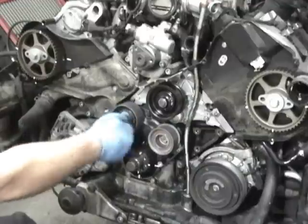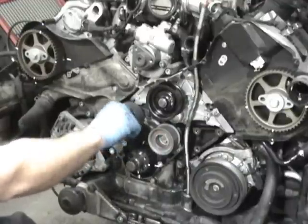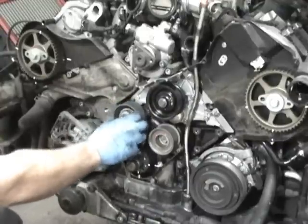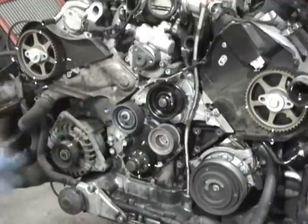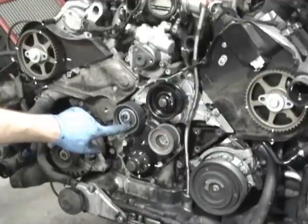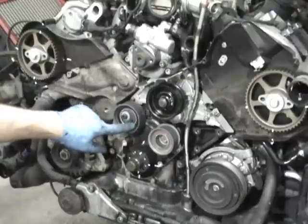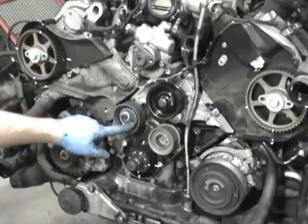And there's a washer on each side, and this is that 6 millimeter Allen. You could tighten this down and that ends up moving like that, and this arm pushes on it. So we'll torque that down to 18 foot-pounds, and you'll see that there is a hex in here. That's an 8 millimeter hex. In case you need to hold tension or check anything, you can use that to move the tensioner around.